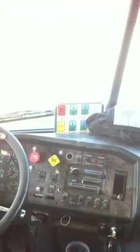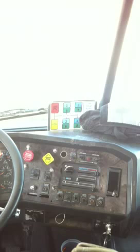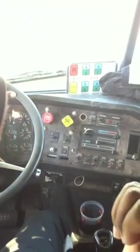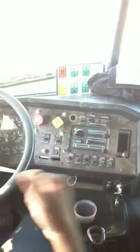I'm gonna check my mirrors on the outside, make sure my mirrors are not broken or damaged, properly mounted, and secured. Also, make sure they're properly adjusted. Okay, I've got a window in the back, so I'm testing that. If you've got a window back there, you check the window in the back. Make sure it's not broken or damaged, and is properly mounted and secured. The rubber seal is not damaged or missing. It's just like those trucks there. They don't have a big window back there.